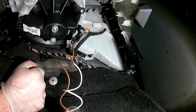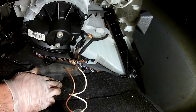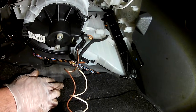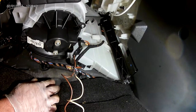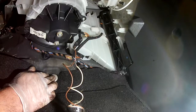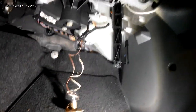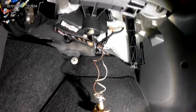If you try all the speeds and absolutely nothing happens at all, try the engine running briefly. If you still get absolutely nothing at all, then chances are it's going to be a fuse — even though you've checked the fuses, sometimes manufacturers will have an extra fuse as a master fuse. Or it could possibly be your fan switch, but check the fuses first.